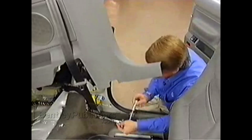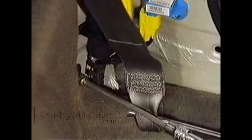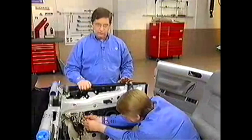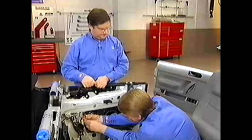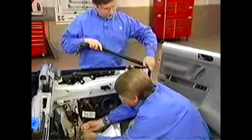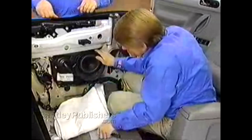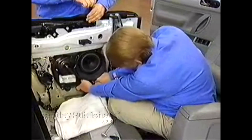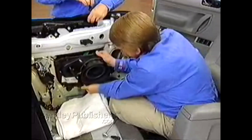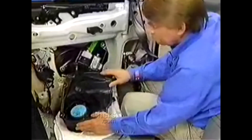Then we're going to remove the side panel. Now that we've got the side panel removed, pull off the inner window slot seal and remove the upper retaining plate. Down at the bottom, take off the retainer for the loudspeaker and carefully lower it down, weaseling it past the wiring harness. Push the grommet through the carrier plate to get a little slack, leaving the connector to the window motor connected. Carefully lay the speaker down on a towel to protect the cone from damage.